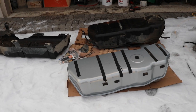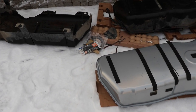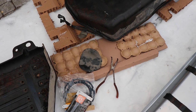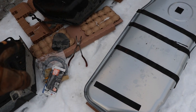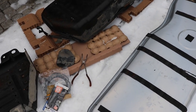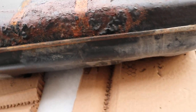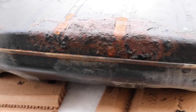My camera wasn't on automatic earlier, so anyway — I got the foam stuff transferred over. I used black Permatex on there. That patch you don't switch over; the tank is molded to have that feature. But you do need to move the little foam strip over and glue it on. This side of the tank is a little bit worse — I would say that's where it had failed.